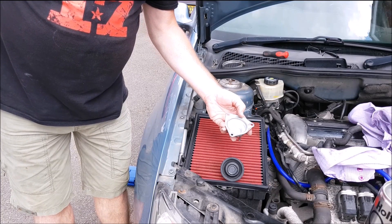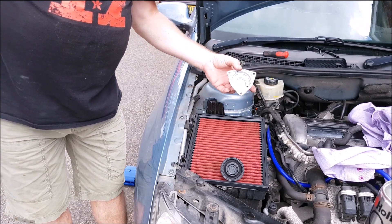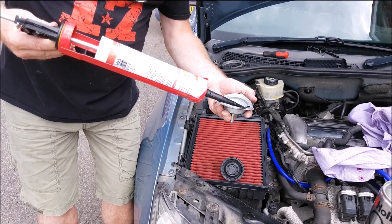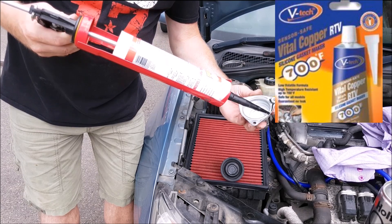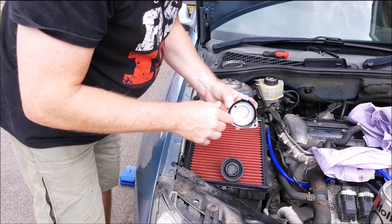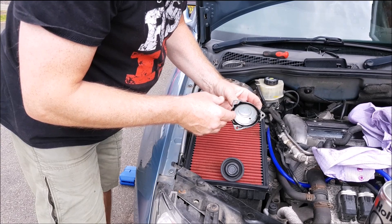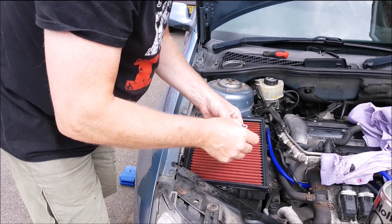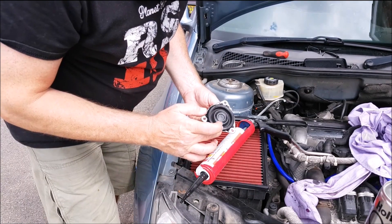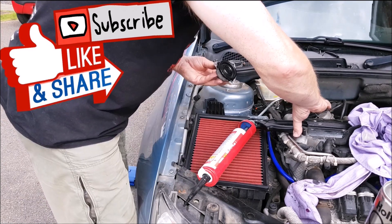To make sure that the periphery of the diaphragm seals against both the valve casing and turbocharger casing, apply a very thin bead of silicone sealer around the edge of the valve casing. Make sure that the sealer is evenly distributed and that there isn't a huge excess. Put the diaphragm back into the casing, press it down all around, and additionally put a bead of sealer around the diaphragm edge.